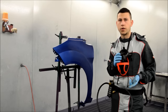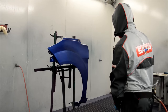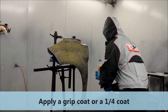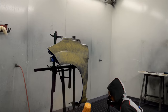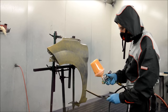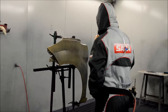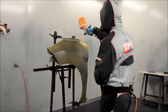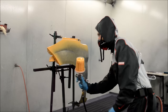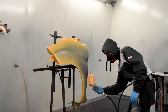I'm going to be using the SATA 4400. I'll voice over this section instead of taking my mask off halfway through — it's easier to follow, and I've had a few comments about health and safety on YouTube. We're applying a quarter coat, or grip coat, as the very first one. I don't really count this as a full coat — it's just to help the waterborne base coat stick to the panel and stop it silking up or running so easily. We're then applying one full wet coat, going around all the edges carefully.